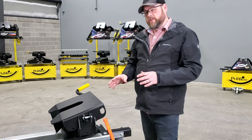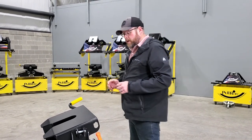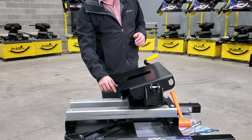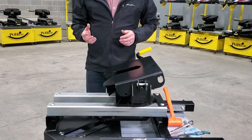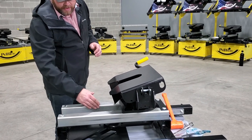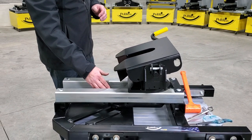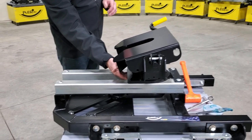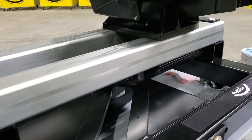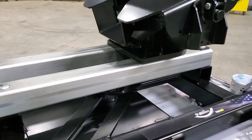In addition to the forward stop, some of the maintenance items that are important with the Superglide — the most important thing is lubrication. These silver tubes need to be sprayed down with WD-40 every day of travel. We want you to spray the top surface on both tubes, then the facing side surfaces as well. Those need to be coated with WD-40, and then shoot a little bit into these plastics in the center of the hitch. You can see a little vertical crack right there in the middle — we want to shoot the WD-40 in there to keep everything moving nice and easily.